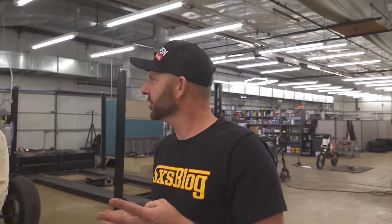The surge tank kit as well - another common thing with Polaris is if you're anything less than like half a tank of fuel, the way the fuel pump is designed, if you're going up a steep hill or giving a lot of gas, fuel sloshes around and it'll start cutting out. I get a lot of phone calls like that - people think they're getting a misfire when in reality it's just the fuel pump. I called Joey a year ago about that with my white Razor - same thing.